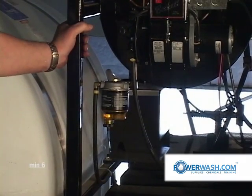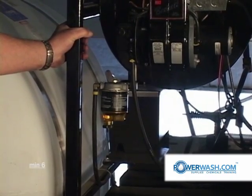If you see a lot of water reoccurring in there, you may want to drain your fuel tank, dry it out, and replace the fuel in it. Some of the things that cause water to get in your fuel are condensation. Condensation is formed because your fuel tank isn't completely full — you have dead air space in there, and what happens is it gets warm during the day, then cools off at night. As that air inside the tank cools off, condensation is formed.